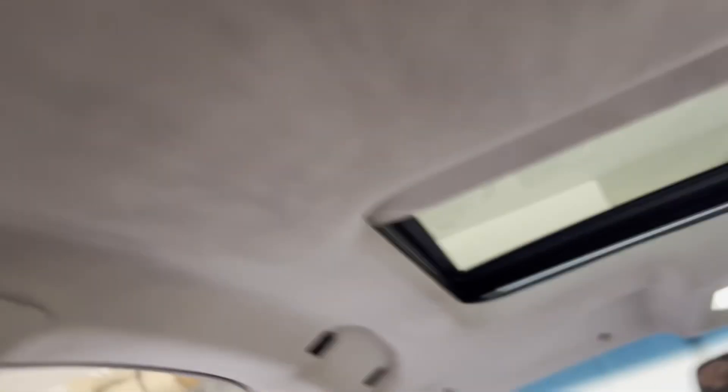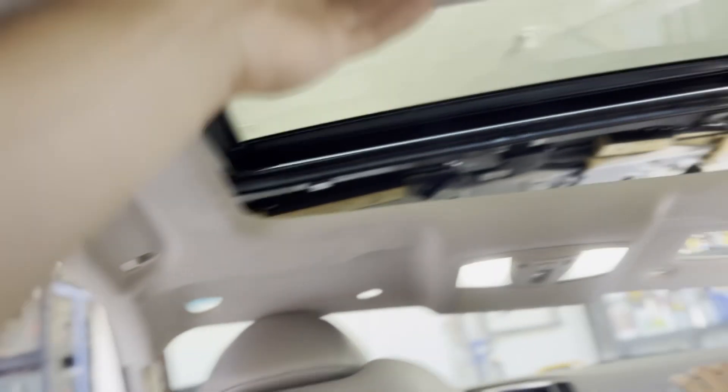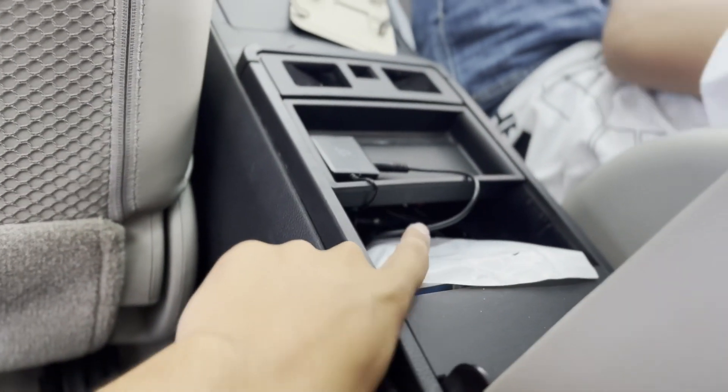So we got the front side removed. Now the issue is how do we get all of these out - that's gonna be a bitch. Found out when you pull on the back of this right here where the sunshade opens, there's a bunch of clips holding on the headliner to the roof, so you gotta pull those down. We're gonna try to take it around this b-pillar and up and out instead of having to take it out, but eventually we're gonna have to take it out because we're gonna run the fiber optics through this b-pillar, down underneath the seat, drill a hole right in there, and it's gonna connect to the cigarette lighter in my center console.